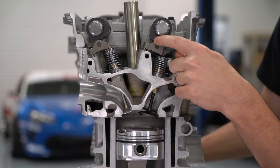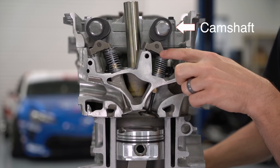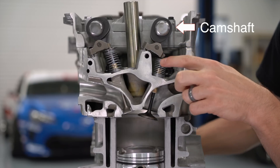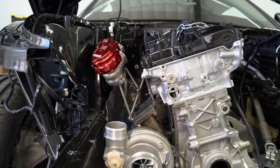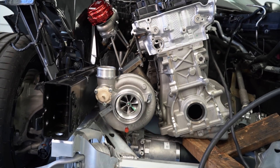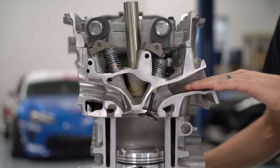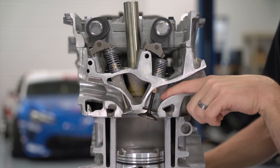The intake is really where most of the power improvement is going to come from. The camshaft turns and opens the intake valve as the piston starts its downstroke in the cylinder bore. Since it's turbocharged, the air is fed into the cylinder with help from boost pressure. Generally, the more boost pressure, the more air we can squeeze into the cylinder. When we add all this air, we need to inject the correct ratio of fuel too — this is where you may have heard of air-fuel ratio.